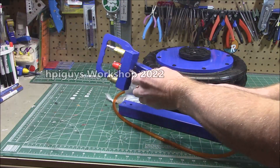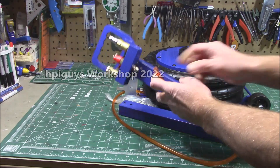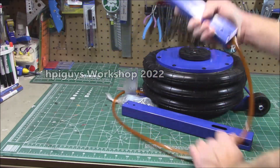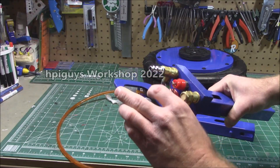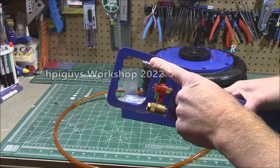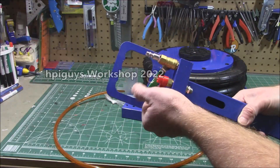Run the hose into this compression fitting — this hose is very stiff, it has to be to handle 120 PSI. When you attach it to the compression fitting, you'll want to warm this end with a heat gun or similar, especially if you live in a colder climate like Wisconsin at 14 degrees. Slide it in there. This is your operational end of the jack. You've got your green line and your air input — you need an air compressor to run this. A 50 gallon upright is much better than a small pancake compressor for filling the jack faster.